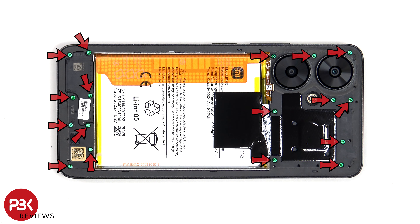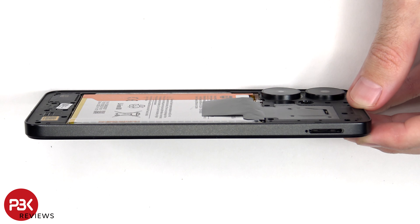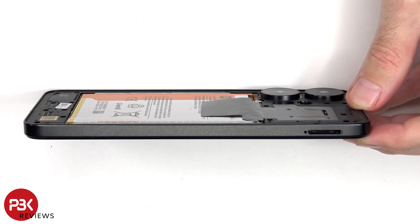At this point there are 17 Phillips screws which need to be removed. Once the screws have been removed, a plastic pry tool needs to be placed in between the back housing and the frame of the screen and ran along the edges to pop off the catches.